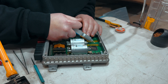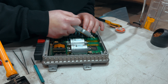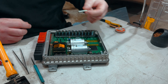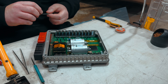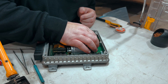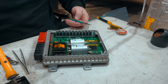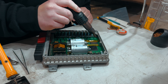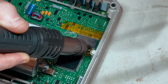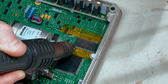Here you can see where we're applying some solder paste — this is easier than individually soldering each pin. We lay a really thin line of solder paste and then apply heat, and as we apply the heat it sucks into all of the metal components. We put the chip back on so it lines up — each of the 44 pins has to line up perfectly, otherwise we get a no connection and a no boot situation on the board.